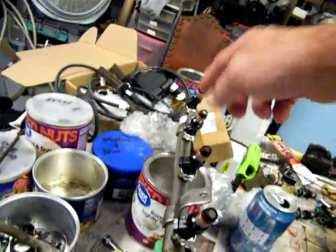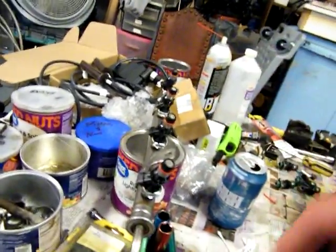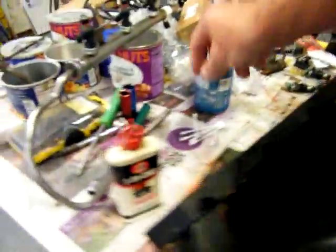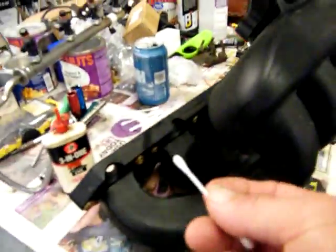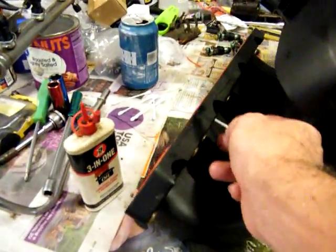I'm going to put just a little bit of oil on your O-rings and in the holes where they go. And instead of just forcing them straight in, sort of twist like that. Then take one of these and put some oil on it and go around each one of these where the injector goes. You can see it here.